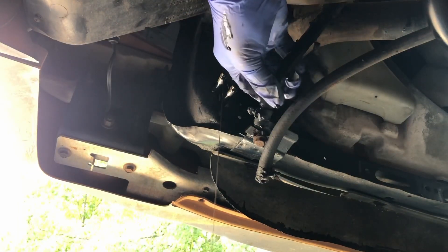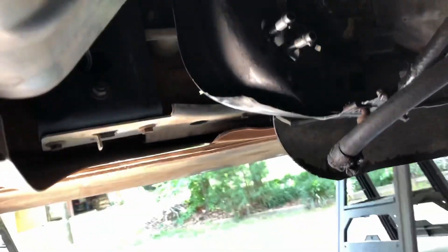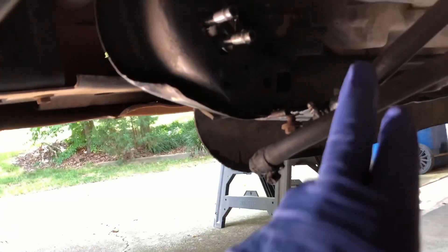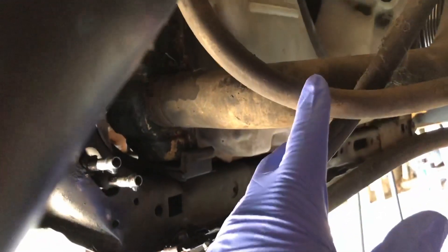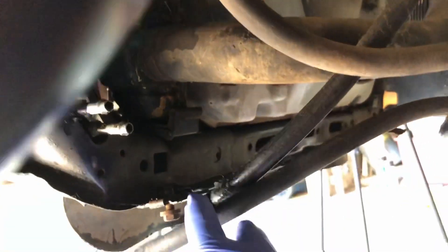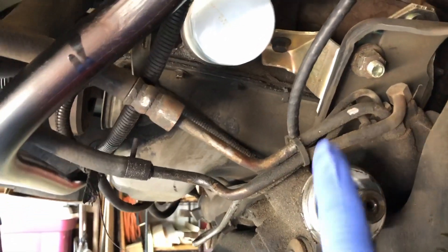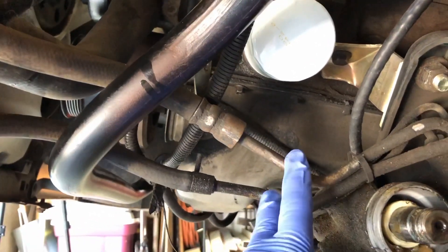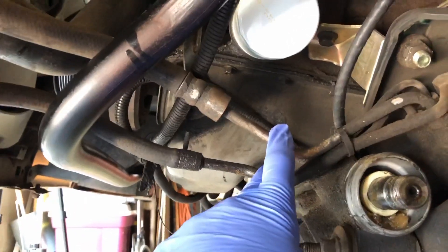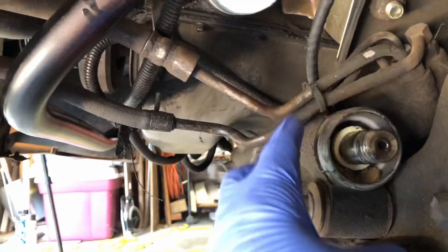Alright, that one's loose. I'm just going to let that drip for a while. These two hoses go to the cooler, and then the third hose right here — those are the three I'm going to be changing. The one from the cooler and this one from the power steering pump both go back to the end of the steering rack. They both bolt in up here. So I'm just going to follow these two lines back and that's what I'm going to unbolt. Before I do that, I'm going to put my boots back on the steering rack to protect it and keep all that gunk from falling in there.